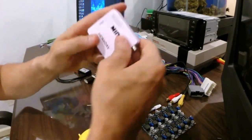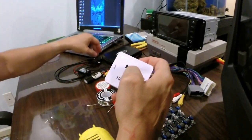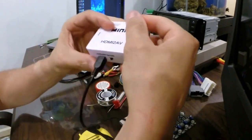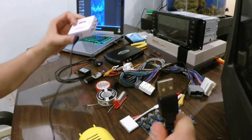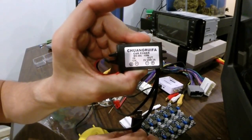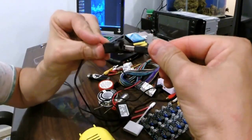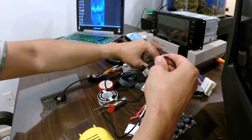The HDMI 2AV needs power — it has a mini USB right here that plugs into the side. So it needs USB power. What I'm going to do is hardwire or solder the 12-to-5 volt converter to the back of the harness. Then we can snap it in place, heat shrink it, zip tie it, and everything goes behind the dash nice and out of sight.